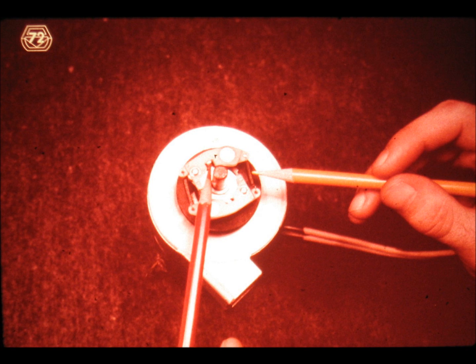If the springs are too weak, the RPM of the motor never quite has a chance to build up sufficiently before the clutch pawls already engage with the motor pulley, thus defeating the very purpose of the clutch. It is therefore advisable to replace the whole clutch pawl assembly whenever there is a need to repair the motor clutch.